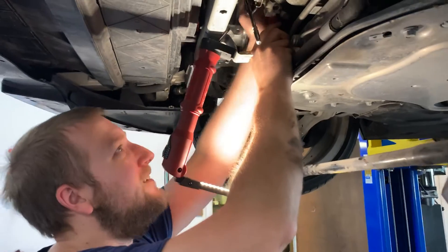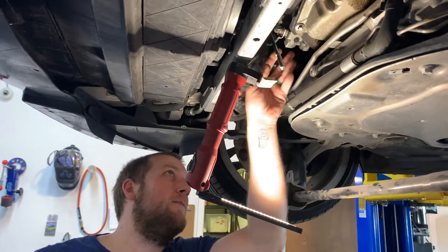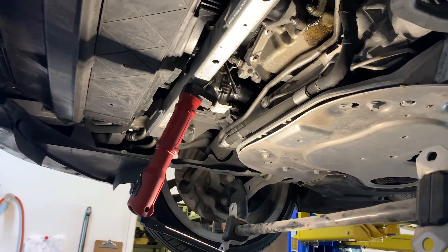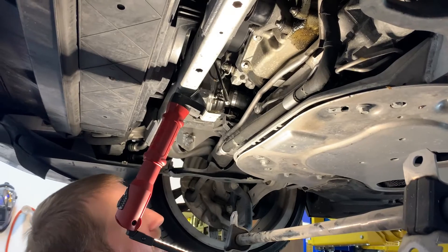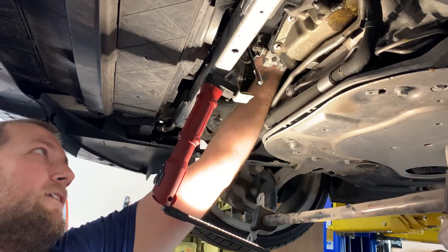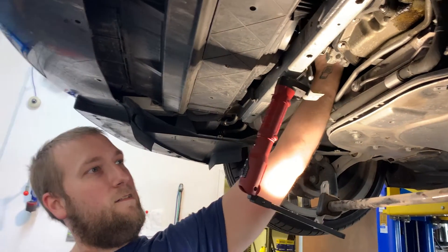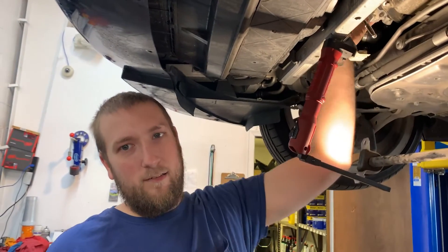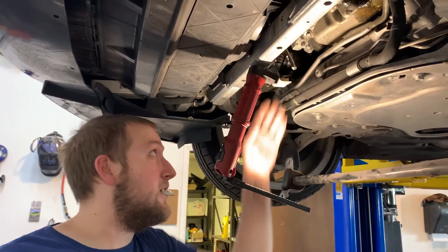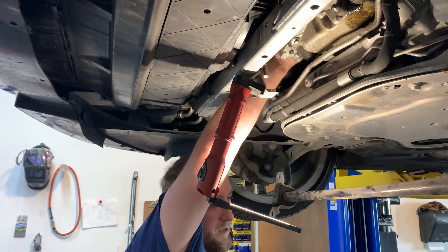So tell me how much of a pain it was. It was quite a bit. There's a plate that bolts right here for the water pump that I took off and it gave me a little extra room. I had to use a really long ball-headed Allen key to get this top one in. So it was the ball-head Allen key that basically allowed you to get deeper. Yeah, and it's long and skinny, which gave me just enough room to get where I needed to get.